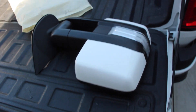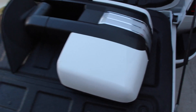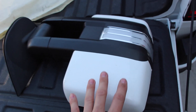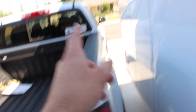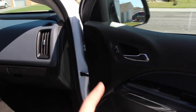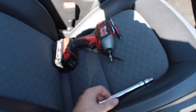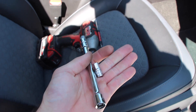And I'm going to go slap them on my truck. I already got one mirror on — I didn't wire it yet because I got to get this mirror on. But the door panel is kind of a pain and it has to come off. As long as you know what you're doing, it's pretty simple. So we're going to do the passenger side — we're going to take that door panel off and slap this mirror on. There are a few things you're going to need to take the door panel off and get the mirror off. So here are the tools I use: I just have an impact, you can use a ratchet, no big deal. I also have a 10mm socket and a 7mm socket.